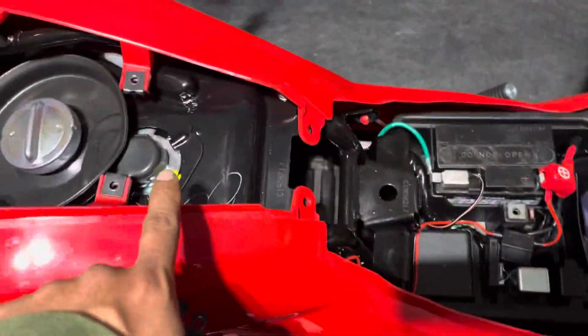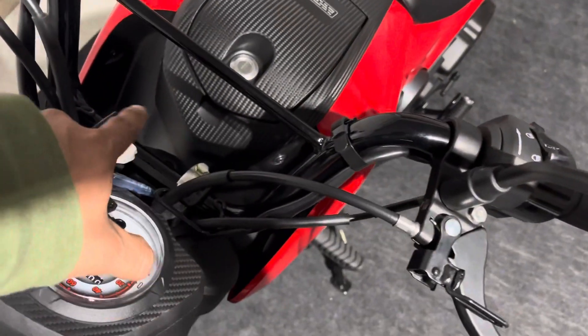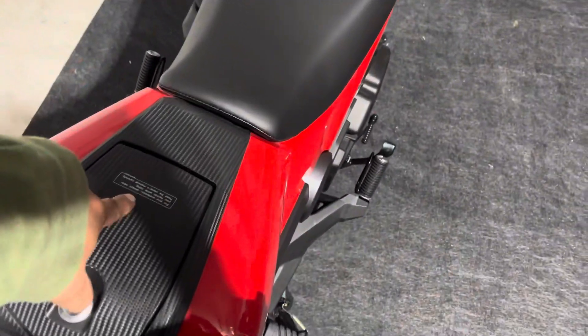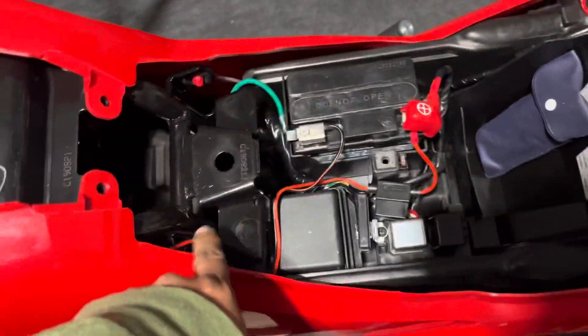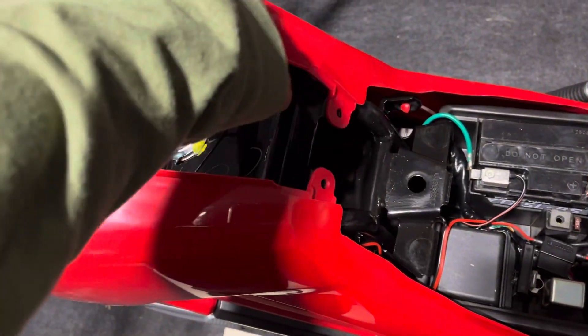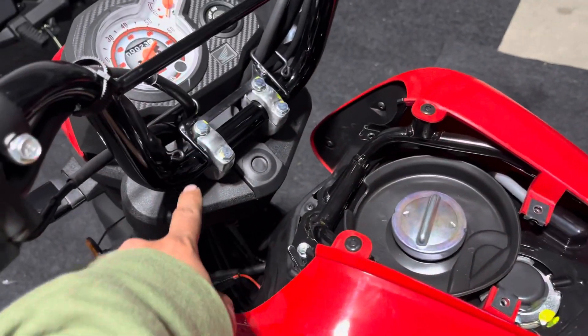The only thing I did was take off the seat, obviously. Then the battery has a small cover with one bolt. The plastic that goes over the gas tank has six screws — two in the front, two under these doors, and two down here. You just take them out, and the easiest way I found was to route it either to this side or that side. I didn't like the way it looked up at the handlebars.